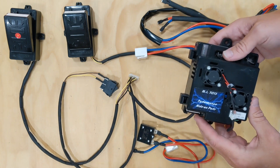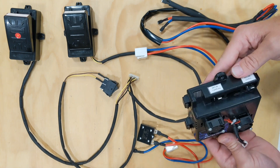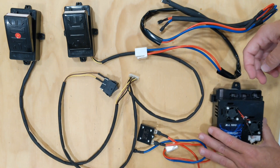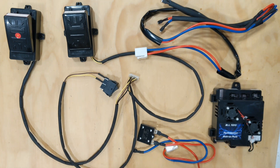You'll have a 35 amp circuit breaker built into the unit, and then of course the speed controller unit itself — it'll be stickered a little differently than our test model, but it's an all-inclusive unit. Installing this kit is pretty easy. The first thing you want to do is remove all of the wiring from your stock vehicle that's associated with movement. If you have wires for lighting or a sound system you can leave those, but everything between battery, shifter switch, gas pedal, and motors can come out.